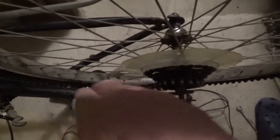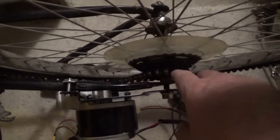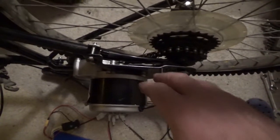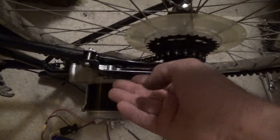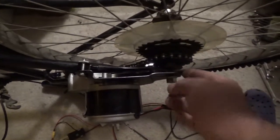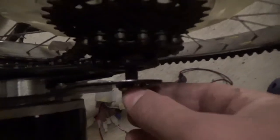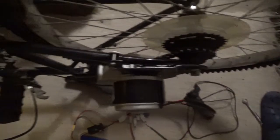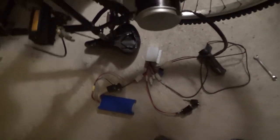Once I got the thing on, it wants to pull itself off — the chain wants to skip off because the motor isn't at the right angle to the sprocket. No matter what I do, I'm going to experimentally try taking this all apart, flipping the mounting plate over, and try to mount it on the inside. But by the time I tighten it down, I've put too much angular pressure outward on the motor shaft and it drops the chain.